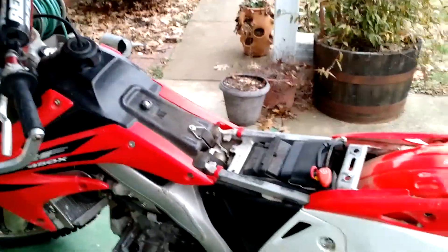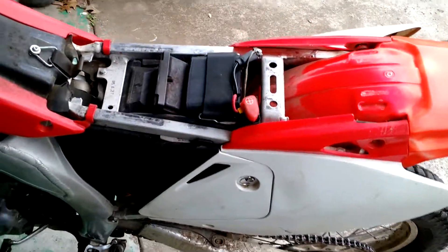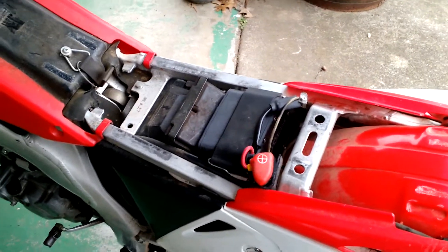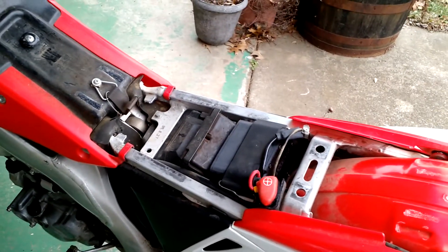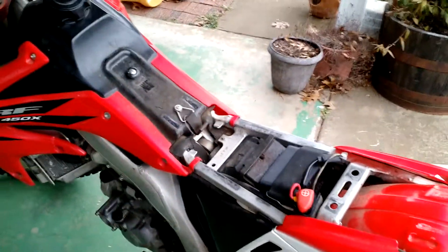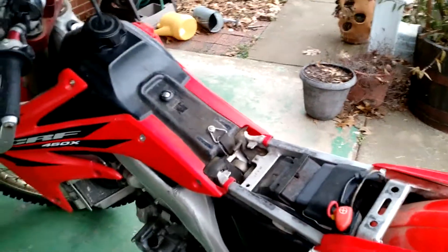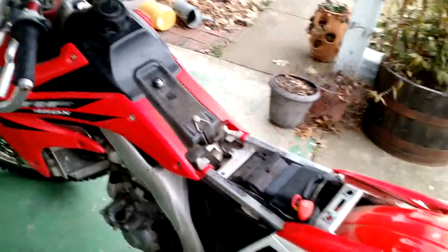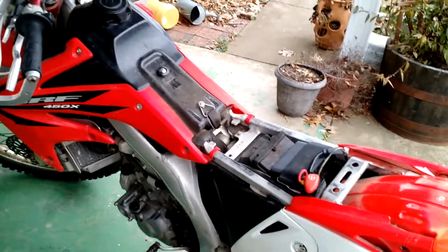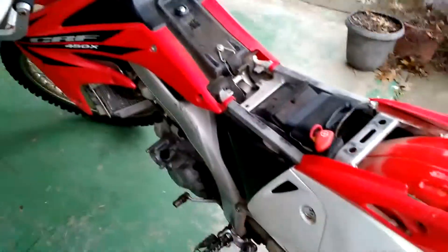Also, you'd have to run a bike for probably an hour or so to recharge a battery after doing that many cranks. With the capacitors, you only have to run the bike around — depending on the bike, I've seen charge rates vary from one to four amps. All the Hondas I've tested do close to four amps of charging, which means these things charge in less than two minutes. Two minutes of run time will completely recharge them if you run it all the way dead. Worst case, you run it all the way dead, kickstart, run for two minutes, and it's completely full again — no damage done. So you're a lot more likely to not be left stranded with the capacitor setup than you would be otherwise. Enjoy, guys — see you in the next video.